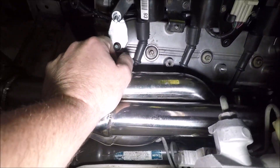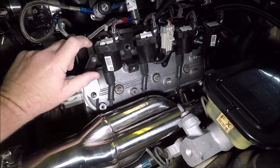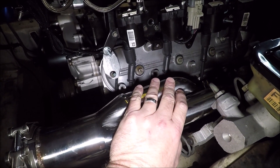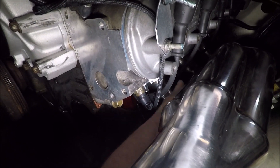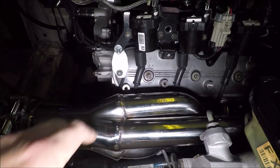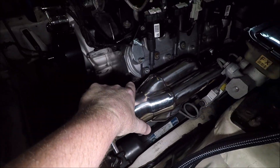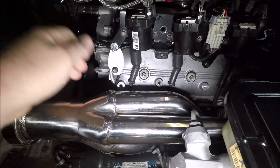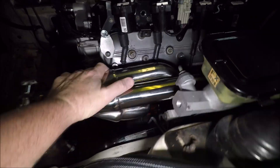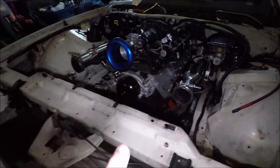This is a great solution because it serves two purposes. Number one, it moves the coils up about two inches and gets them away from the heat coming off these turbo headers. Number two, it gives you plenty of space — you can see I can get my finger between the header and the wire. I'm 100% confident with it like this. I'm still going to wrap these headers, but there's really no need for heat sleeves on the wires now, although you could still use them. It's totally unnecessary now since there's plenty of room.